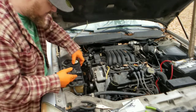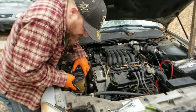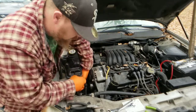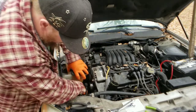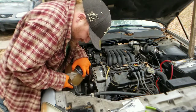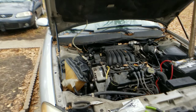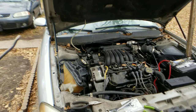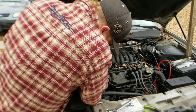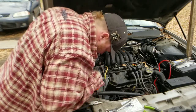There's nothing wrong with that. You've got the two coolant lines at the top and a coolant line which goes to your radiator at the bottom. Just get that off. This will make it a little bit easier. If you do have the Serpentine Belt tool and your bolt's not messed up, then use the Serpentine Belt tool and make your life a little bit easier. All right, coolant tank's off — get that out of the way. Get the 14 and the 15-millimeter. I'm going to put the 15 right on there with the closed end.